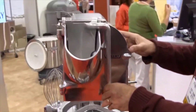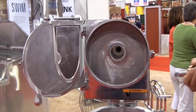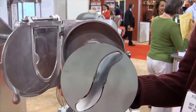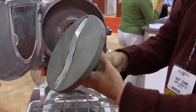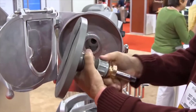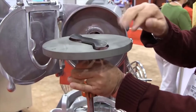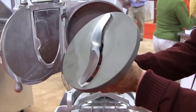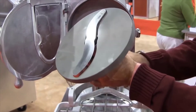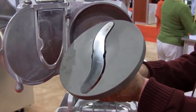The front of the hopper opens easily. This is the slicer plate — it's nine inches in diameter, which is why it's called a nine-inch plate. It adjusts by turning this plastic ring here; you can see that the blade extends itself out from the plate, giving you a thicker slice, or you can crank it down and get a very thin slice of typically vegetable products. That's the most common.